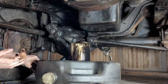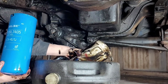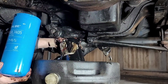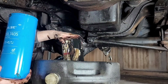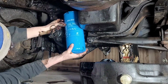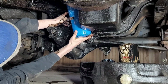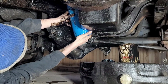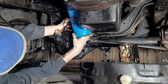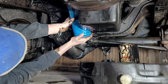Here's a comparison between the two oil filters. Now this Donaldson filter will just barely fit in there. There it is. Holds an extra 2 quarts of oil. You're hugging almost right up against the oil pan when you put this in. Some of these trucks, depending on which year, make and model, for your 7.3, there's a sway bar for this front axle that won't clear.